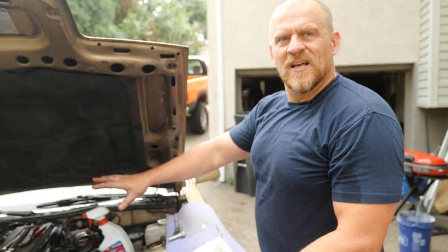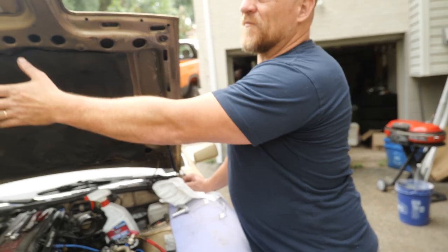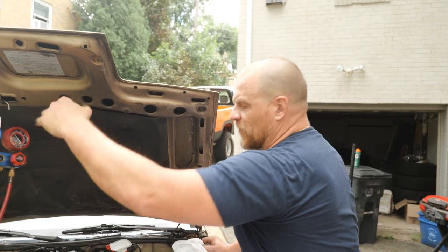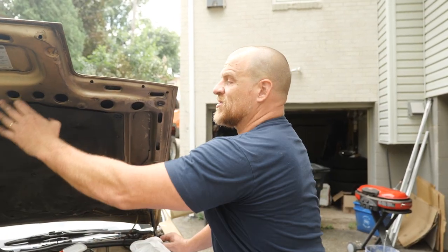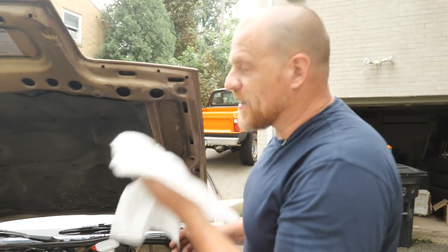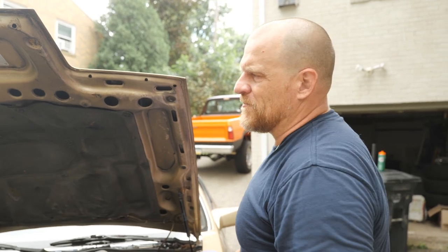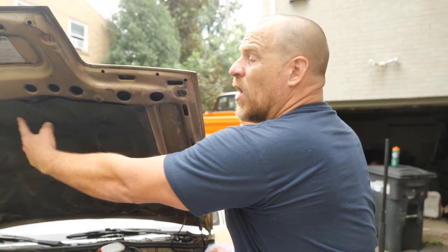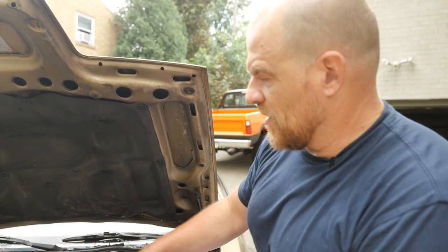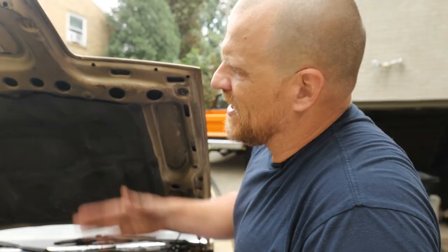I have an empty system, and I'm pumping all that pressure in here, and I'm not filling from the low side. I'm filling from the high side, and it's hitting that gauge first before it goes down into the system. And so pressure's high before it squeezes into the system. And I think that's exactly what it was. Normally, when I do this, I would add from the low side and then watch the high side gauge, which would be after the effect. So we're putting in the low side, filling the system, and then the gauge is the last thing in line instead of the first thing in line, and I jumped the gun.